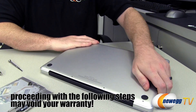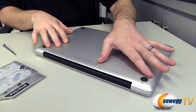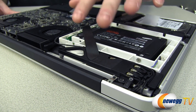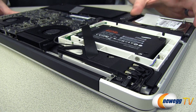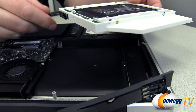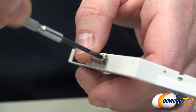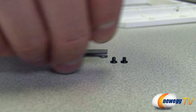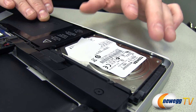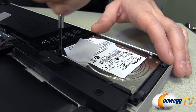Remove the back plate and next we're going to uninstall the caddy and unmount the SSD — simply do the same process in reverse that we did in part one. Remove the screws as well as the cables that might be in the way and pop that caddy out. Next, remove the metal bracket that was attached to the optical drive and attach it to the caddy. Note that there are two longer screws that come with the Silverstone Caddy that you'll need to attach that metal bracket. We're going to be swapping our new SSD into the place where the mechanical drive currently resides.